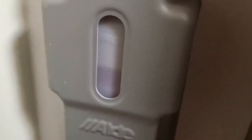In the wardrobe just here we have our Alde header tank, and as we can see it's at maximum, which is nice. Over time though you might find this lowers. Simply top it up with Alde antifreeze, or if you need a bit of pinch you can use distilled water. To do that, this little bit at the top here just comes off the top, like so, and that's where you'll see the screw thread. Simply undo the screw thread and pour it into the top.